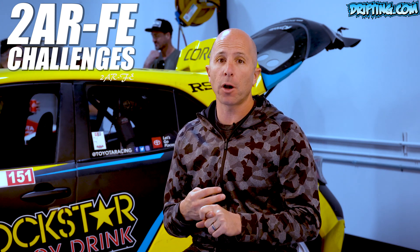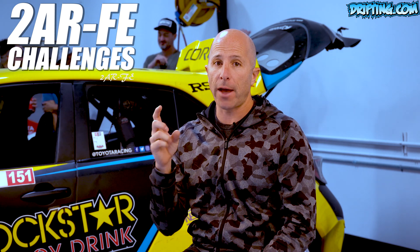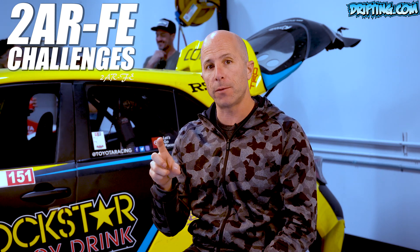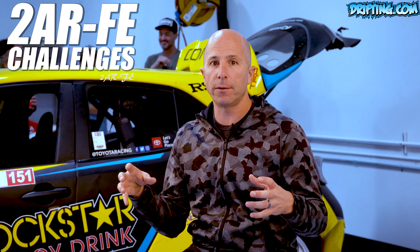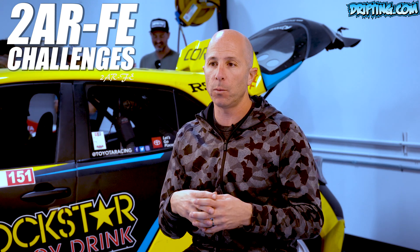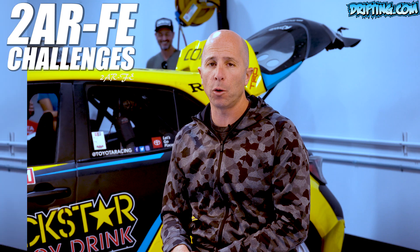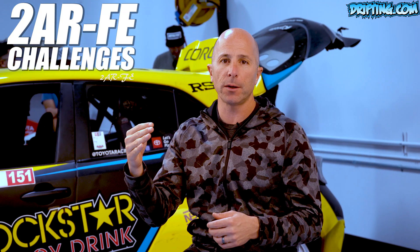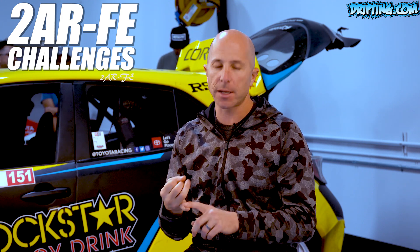The second thing that's been really hard about this engine is valve train. We change everything from the valves to larger stem valves, different valve guides, larger diameter springs. We do a bunch of machining on the cylinder head to allow the installation of all of these custom components. We do custom rocker arms, grind the cams to a custom profile. Every 200 horsepower that we go up, we end up with another problem to resolve. But the biggest problems have been the head gasket and the valve train, and we're pretty sure we've worked all that stuff out now.